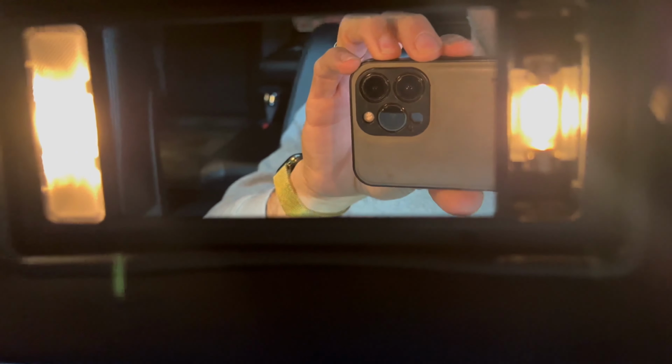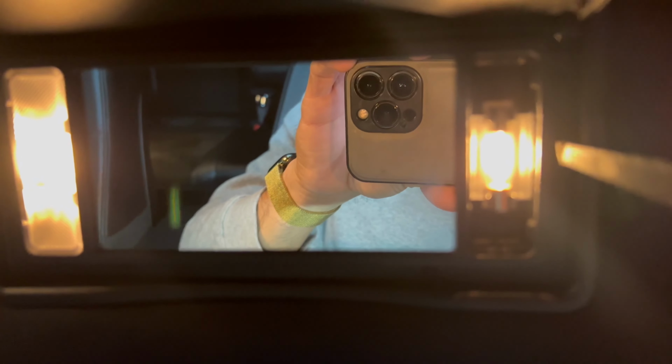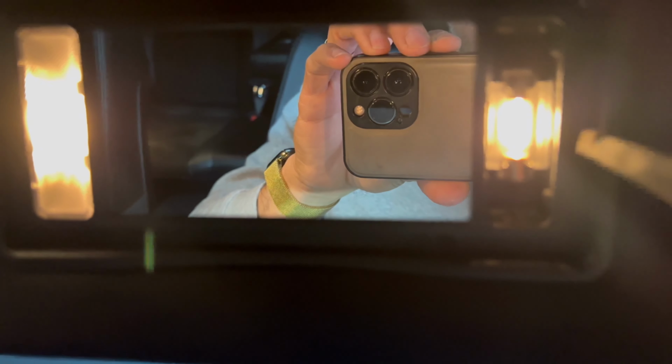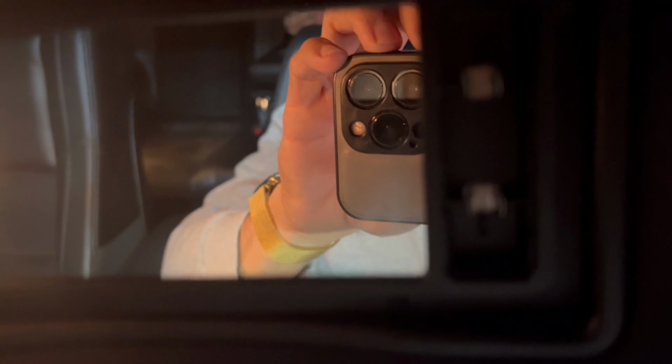And now to take those out, these light bulbs, use your pry tool. And if you don't have a pry tool, just take a flathead. And if you can, take electrical tape and wrap that around the tool so it doesn't scratch your pieces. There we go. I just use this part right here, and then place it here and put the new one in.